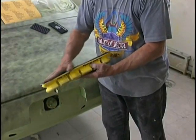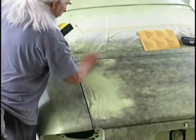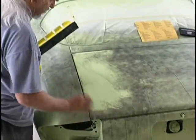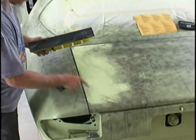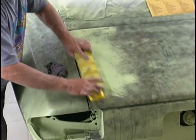Use the X method that we used through the whole sanding process on the bodywork and everything else. The guide coat shows you your blocking errors, the low spots. Just keep blocking till they're gone. Because of all the previous work that we've done, we know that this primer is going to get us where we want to be. Each dried wet coat of primer should put on 1 mil. So that means we've got 3 mils of primer on there.